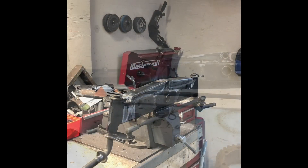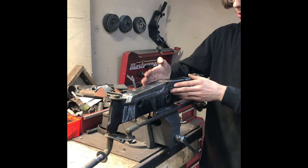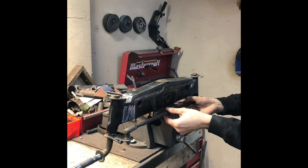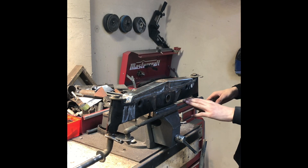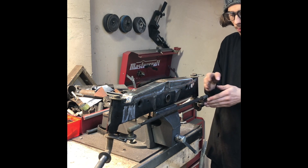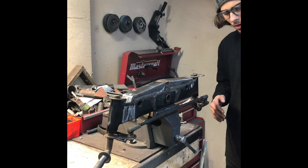Okay, there it is - this is just very rough, I still have a lot to do. To give you guys an idea: this is the front of the mower, transaxle and everything's in the back. Putting the steering around back and behind, that way it won't get bent or anything - I like that system instead of in front of the axle. It needs to get lengthened out because if this one's straight, that one's very cocked. The steering linkage is coming in on the right side instead of the left, so it's going to be pushing and pulling right here.